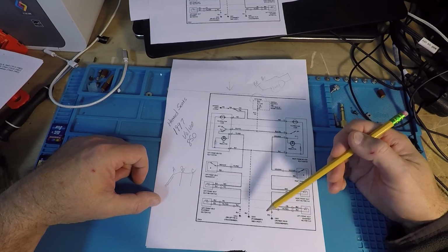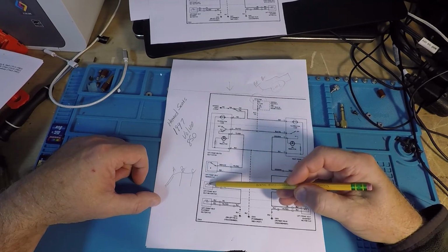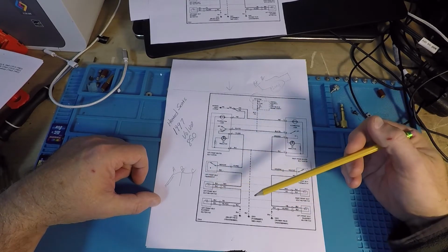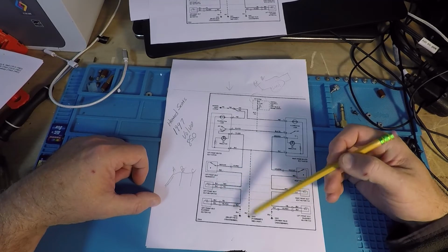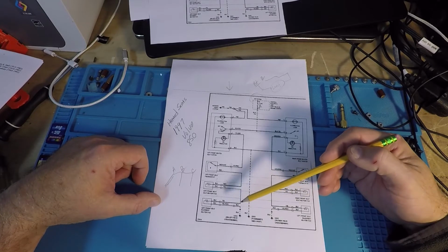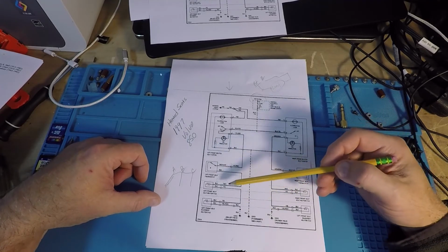You can see all of this on the vehicle very clearly, but I want to show you on this before you look at the seat and everything gets confusing. So it goes in the red, goes through the first seat heater pad, okay? This is the bottom one, your bottom seat heater pad. Now, what is cool on this one and a bit conflicting is these heating elements, unlike the S60, these are in series. In other words, just like those Christmas lights that you hated years ago where one bulb goes out and the whole thing doesn't work. Yeah, I like the movie Christmas Vacation too.